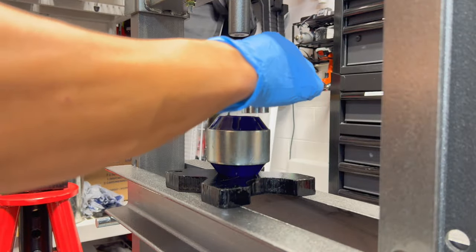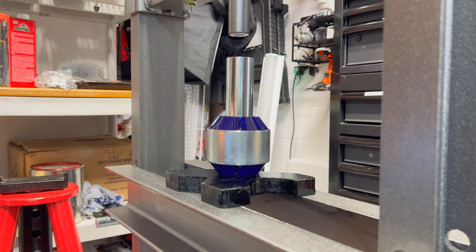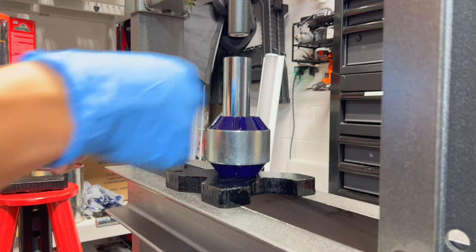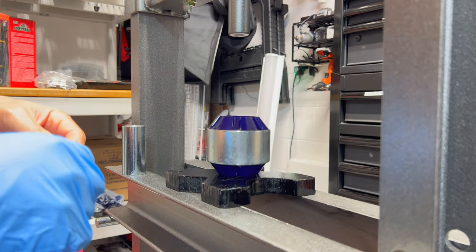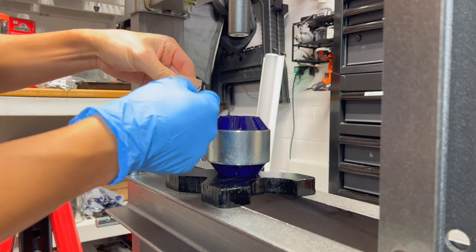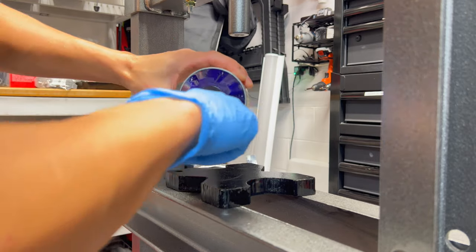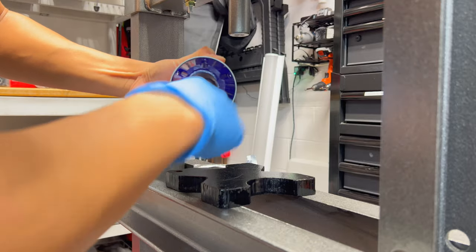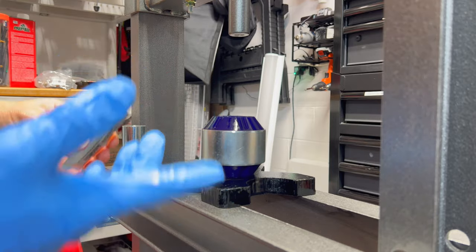I'm over here with the press. I'm going to go ahead and try to press the sleeve down into the hole. Before we do that, we want to put the installation grease on the inside of here just to grease up this thing so it slides in easier. Plus, it'll fill in those ridges inside there and provide a little bit of lubrication when it's permanently in there. So just open this up and fill the inside of this thing up with grease. Make sure you put a bunch in there - the more grease the better because it's going to get into those little grooves and the crosshatch inside.